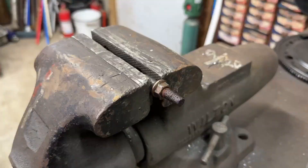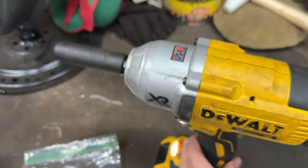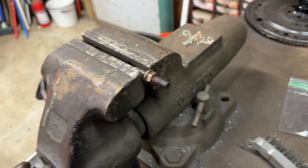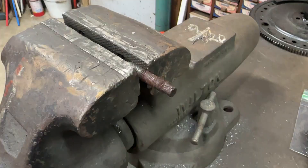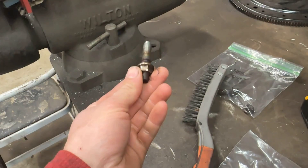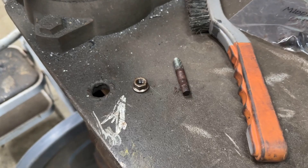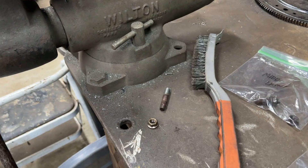I have the stud and nut in the vise. I'll try to scrub the threads clean with a wire brush first and drive it out with the impact without any lubricant or heat. Without anything else besides the impact and vise, I was able to get it out. The threads are clean inside — this saves me from getting new nuts. Second stud came out just as easy. So now I have the old studs, three nuts for each side, plus the middle exhaust coupler piece. Heading back to the Subaru.